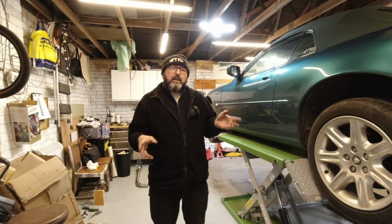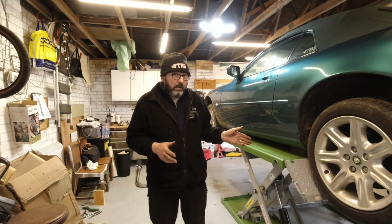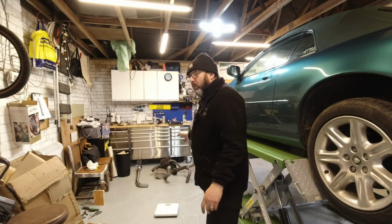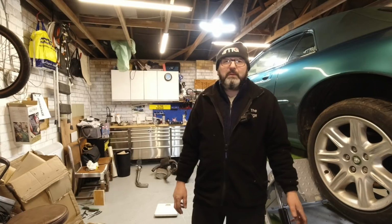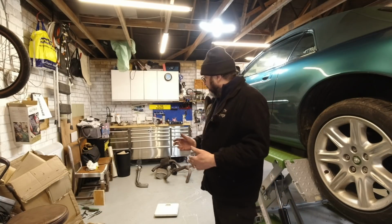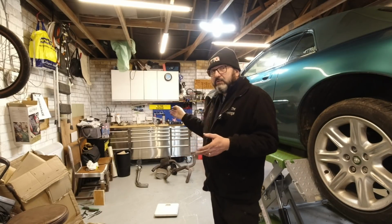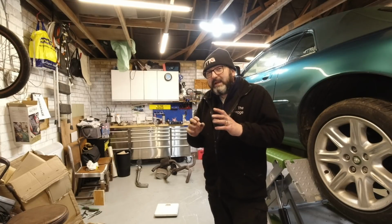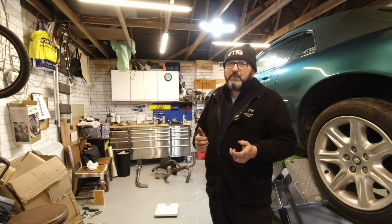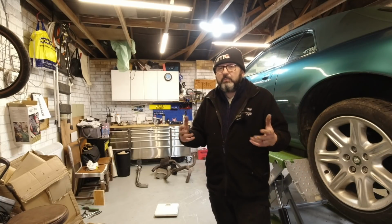That's how you remove the overaxle boxes from your Jaguar XK8 or XKR. And you've seen why it's a pretty good idea if you want a little bit of extra performance or a bit better growl to remove those very restrictive pipes. The resonators or silencers themselves are not actually very restrictive. So it's the combo of pipes, angles and bends that gives you that extra potential in terms of a little bit more horsepower, a bit better breathing, a bit better economy, a bit quicker pickup, all those sorts of good things.